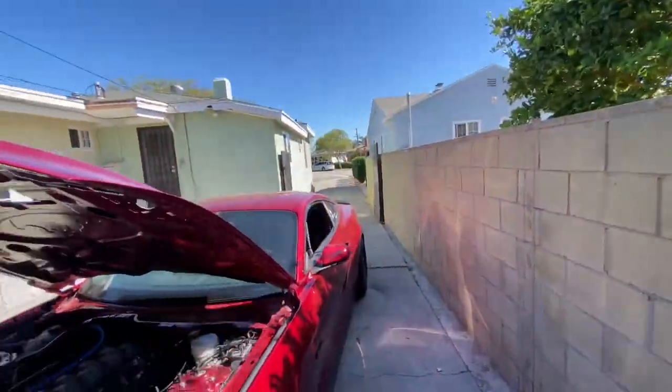I did some runs on the street and came back to practice the trans brake on my driveway. First I went in and changed the setting from 3300 — that was as high as I could get at the drag strip in the last video, check that out. I was able to go from 3300 stall up to 3500, which is the limit. I tried 3700 but it caps at 3500, that's all it's capable of. So that's checked off the list — it works.